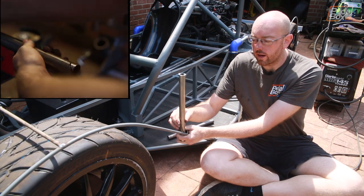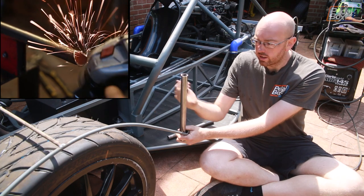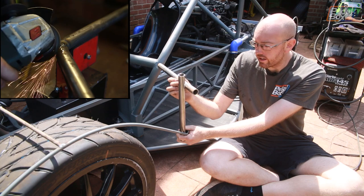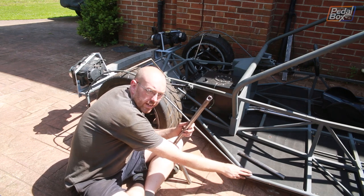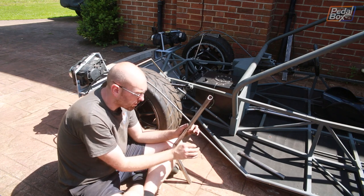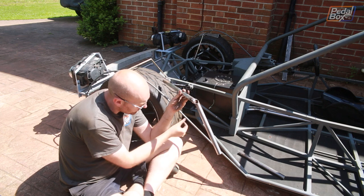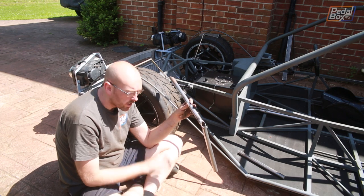This piece is going to go absolutely dead vertical and will form the rear edge of the front clamshell on the car. It's going to come up, but not to the same height as the front arch — it'll dip down a little bit to be level with the dash bar, and the bar is going to be extended out again in inch. I've cut this end down so it will fit roughly onto the end here, and at the other end I've cut out the lower quarter of the tube so that we can slot it over the top, and this line will run really nicely down into the edge of the car.